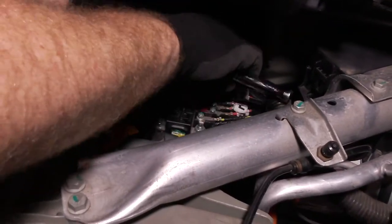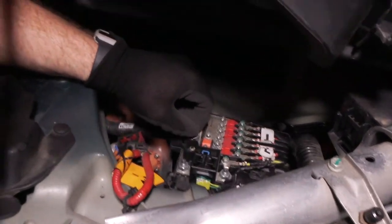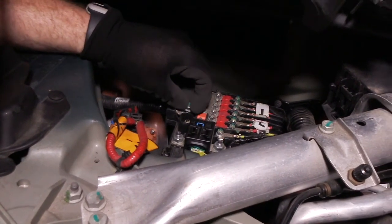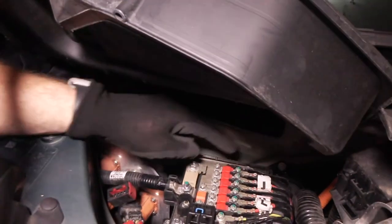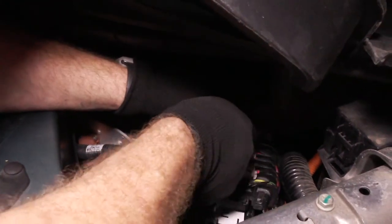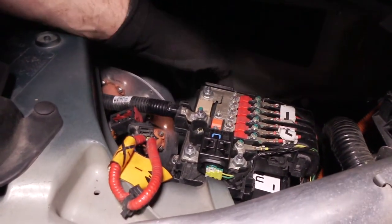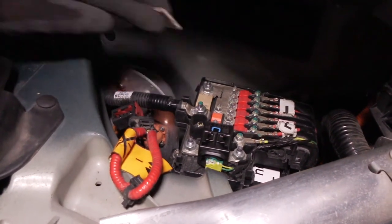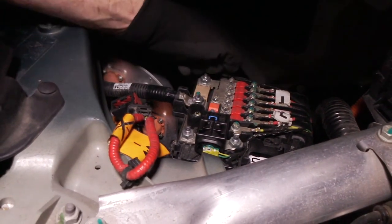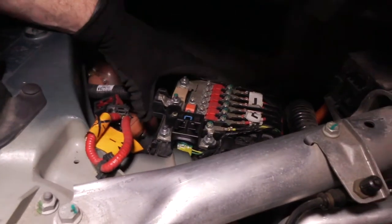Be careful not to touch anything metal there anyway, because that's the positive side, right? Yeah. These two are so weird. Between your two 13 millimeter bolts, just be careful to know which one was which when you take them off and put them back on the correct side. Because one will fit over the other, but then the other side won't fit. This nut or this nut, either one will fit on this side, but on this side, only this nut will thread into it. They're different threads.